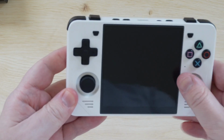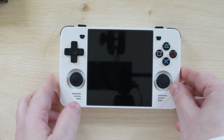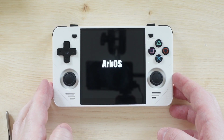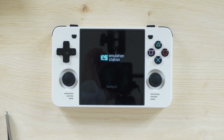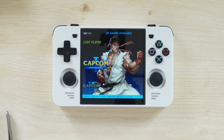Initially, my device turned on but nothing came up on the screen. I took it apart and reseated the display cable, but it still didn't work. After quite a long time troubleshooting, I realized I had forgotten to put the SD cards back in. Anyway, with the SD cards reinserted, the operating system booted right up, and everything seems to be working fine. If you didn't install the rumble motors, you can go ahead and screw the back 4 screws in and you're done. But if you did, we can enable rumble in the operating system.